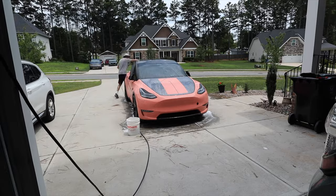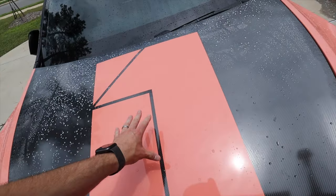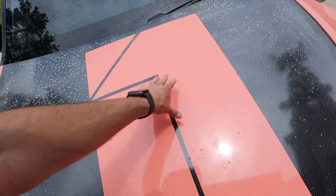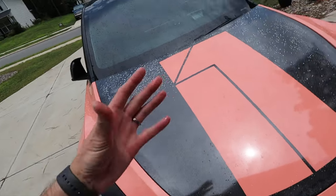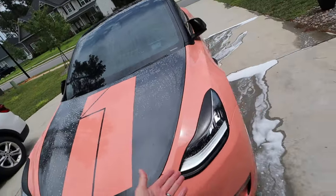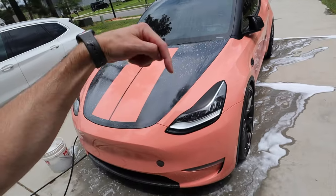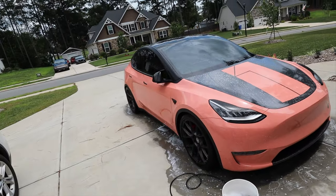Now I just need to dry the car. The cool thing is with the lower pressure, this vinyl is sitting on top of other vinyl or PPF — this is a carbon fiber PPF, ceramic coated with stripes over top of it — and it still did not pull away the vinyl sitting on top of a ceramic coating. So that's really good, because you don't want to damage your paint with high pressure. 2000 PSI is way too much for a car, but 1000 PSI is really good for vinyl. A lot of people ask me that. So even if you have a pressure washer, get a 3.0 nozzle — I'll have a link below for one that works really well — and that way you don't damage your car.